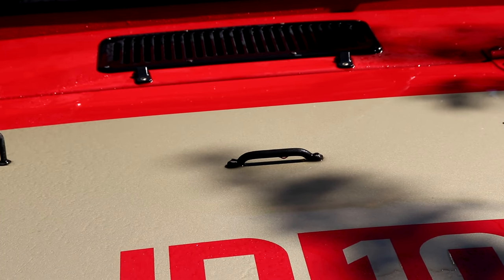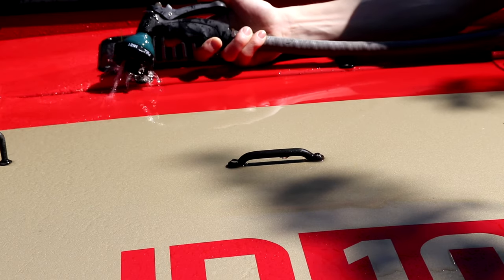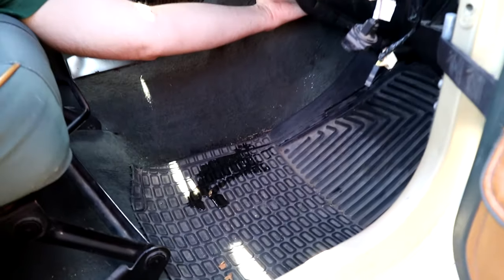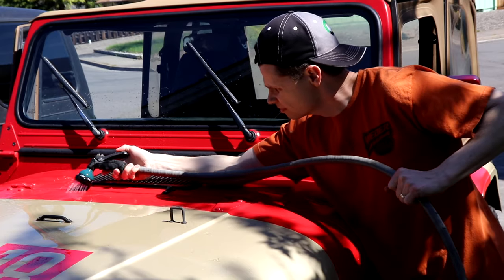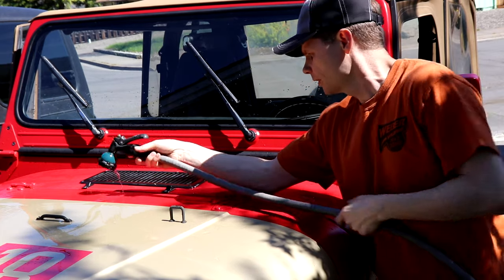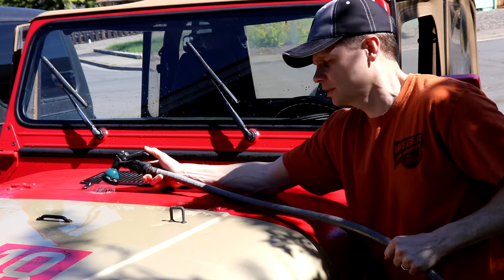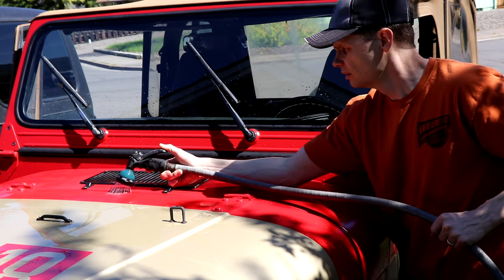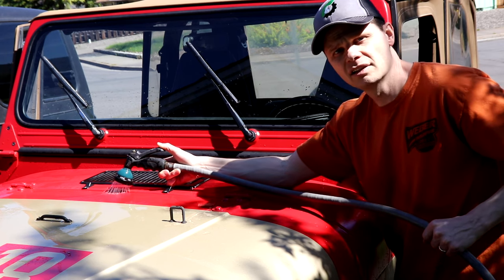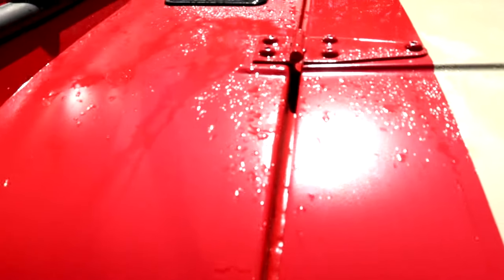Here comes a fresh stream coming down my fingers, and then it kind of slacked off a little bit. It's coming from here — wherever you were spraying. We have some leakage on the passenger side, but it floods on both sides randomly. I did hit the cowl vent a little bit more before I started doing this seam. So I wonder if the vent was starting to fill up before it started to leak. I'll just keep hitting this seam and tell me if it gets any worse. Yeah, it's like flowing in here. It's coming out of the bottom of the vent here — it's flowing in.